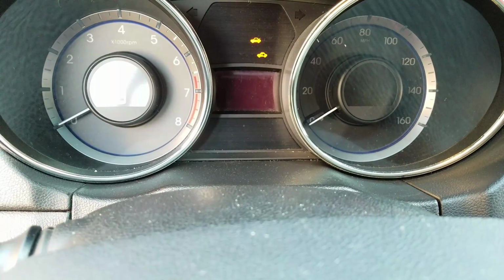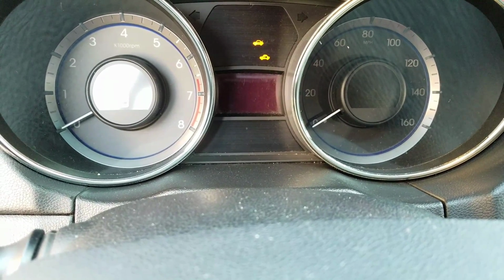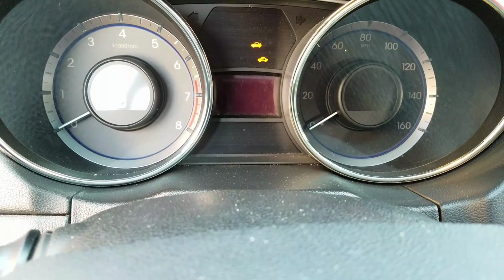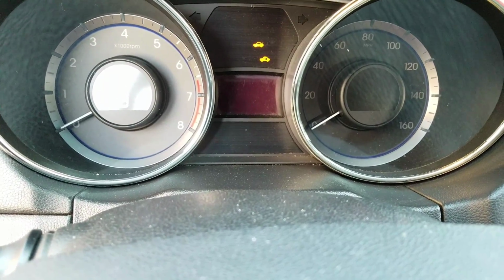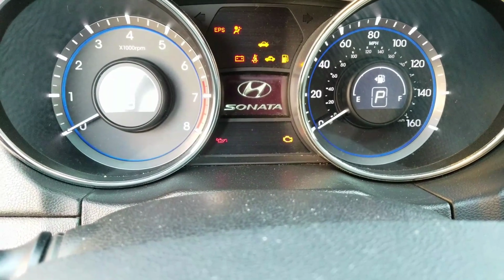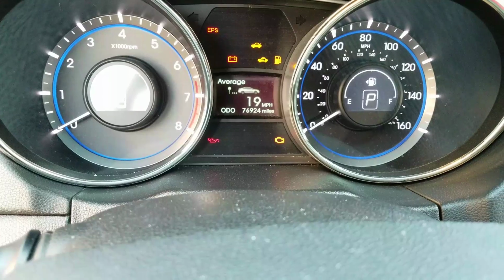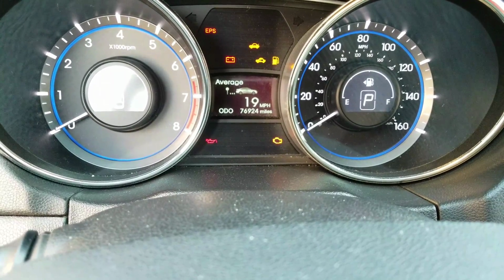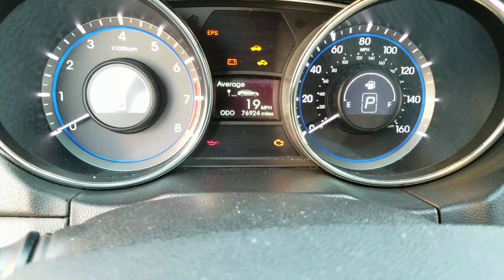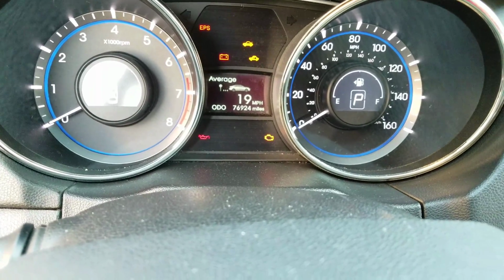Okay, that little amber immobilizer light is only supposed to be there until a recognized key is in the ignition and it's turned on. Well, this is turned on. This vehicle has a no fuel problem. A quick shot of intake cleaner down into the intake was enough to say, okay, yes, we definitely have a fuel problem before we go any further.